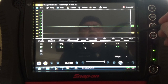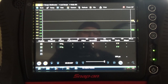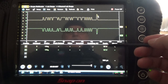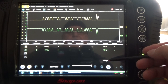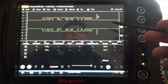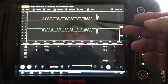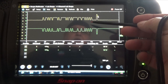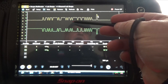I want my high here, and I'm going to turn it on. Hope you can see it here — I got my scale at 10 volts, I got my sweep time at 200 microseconds, I'm using two channels, and this is what the waveform should look like. This is a picture-perfect waveform. In real life it's going to be something close, but not that picture-perfect.